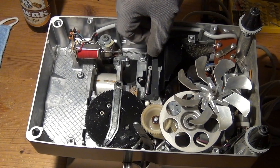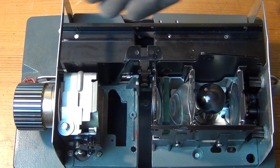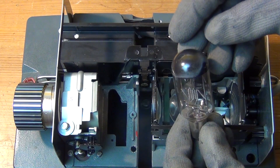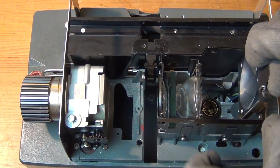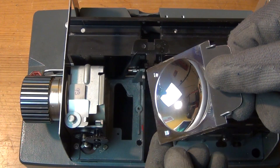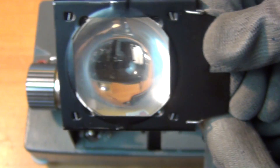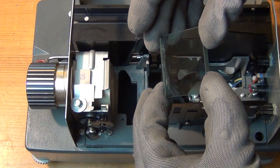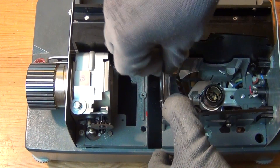In the last episode, we took a closer look inside the old slide projector, and the only thing I didn't really talk about is the optical system. So let's talk a little bit about that, and we will also compare it to the insides of our second slide projector. Behind an old-fashioned incandescent light bulb that serves as the light source, we find a spherical concave mirror — in German called Hohlspiegel — which catches the light that goes in the wrong direction and casts it forward. In front of the lamp, we find a curious-looking convex lens called an aspheric lens. After that, we find this piece of glass called a Wärmeschutzfilter, which means heat protection filter. And in front of that, we find another lens called the condenser lens.